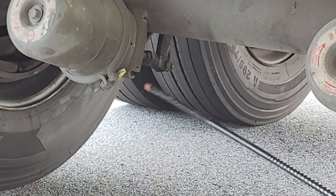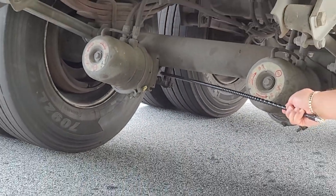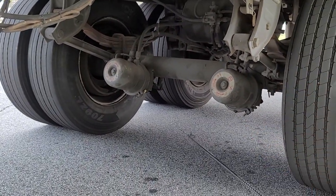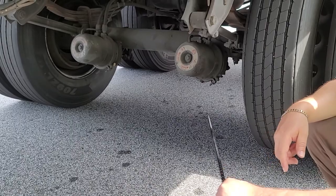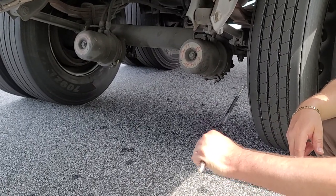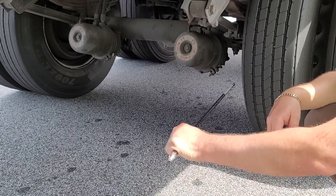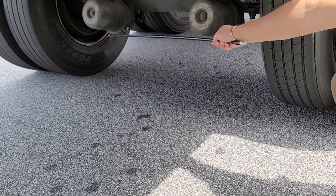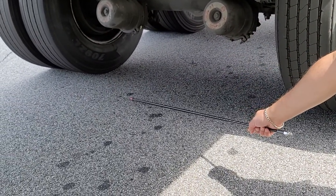I don't want to have more than an inch of excess travel when the brakes are released on the push rod. Remember, you're talking about only one side. You can refer to the brake linings — minimum of a quarter inch, no cracks, no contaminants, and they're securely mounted.